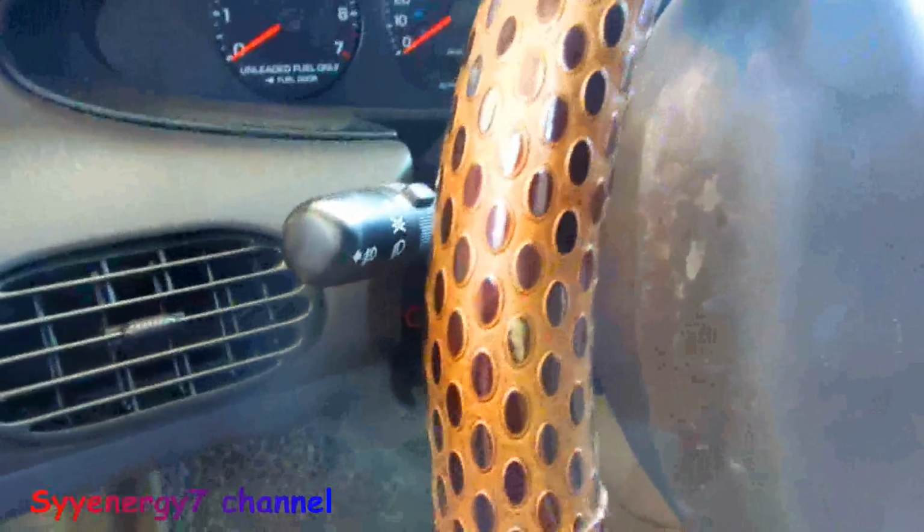Now I got the covers off, the wheel, which is easy. There's only two screws. You can see them right down there. That's the bottom one with the key. They just come off, and if you got the tilt wheel, probably best to tilt the wheel down so you could take the top one off a little easier because of this little lip.